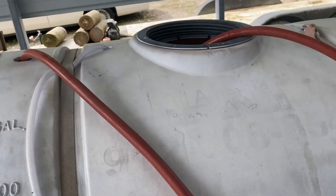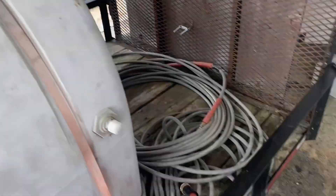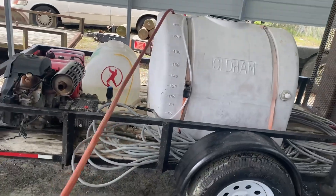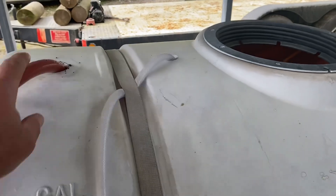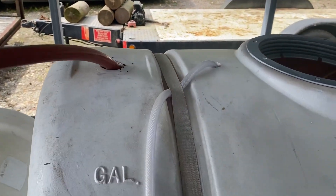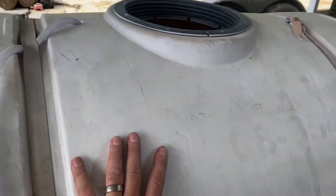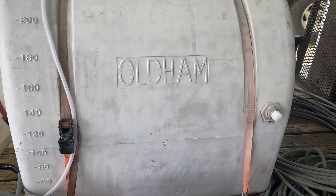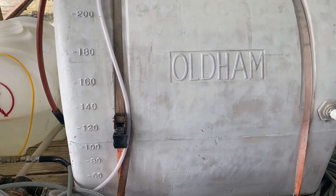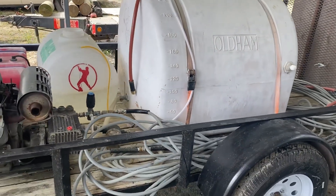Where's your water supply line? There's a big hole at the top of this tank. We feed our water hose into that, and when we're ready to connect to the house, there it is — you just pull it on out. When you're done, slide everything back in. This actually serves two purposes: not only does it replace a hose reel, but all that hose inside the tank helps reduce the slosh, so when you're driving up and down the road and hitting the brakes, you're not feeling that momentum of the water as much.